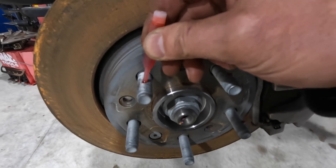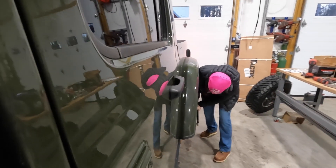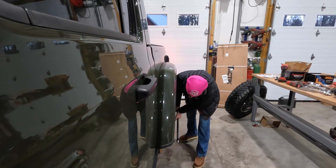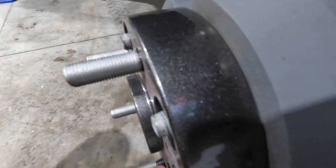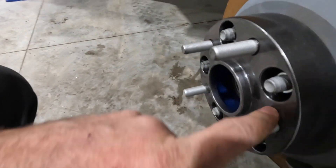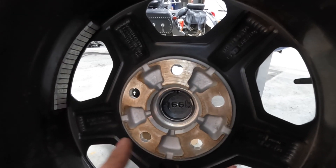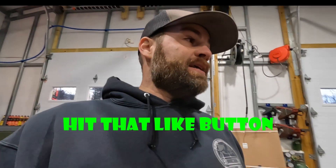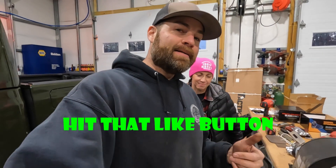She's putting the spacers on now - good to have her in the shop working. I can't put too much weight on my shoulder - it's still sore - so she's torquing the wheels. One thing to note: your factory lugs may protrude a little bit beyond the spacer depending on thickness. In this case they do protrude slightly - you want to make sure your wheel has a recess that allows for that so the factory wheel still sits flush. Don't forget to check that. This would be a great time to subscribe to our channel!